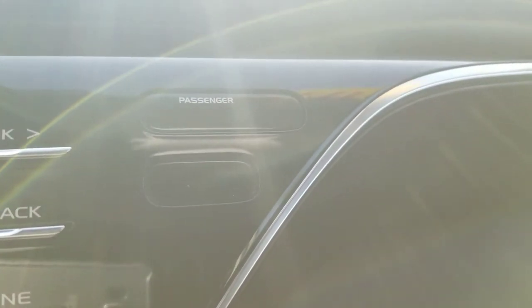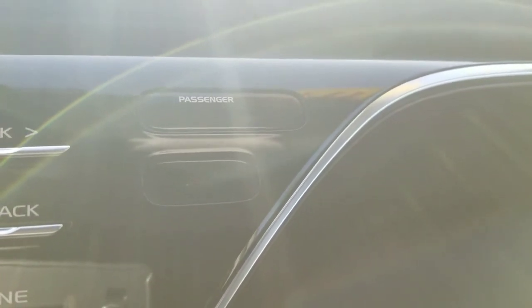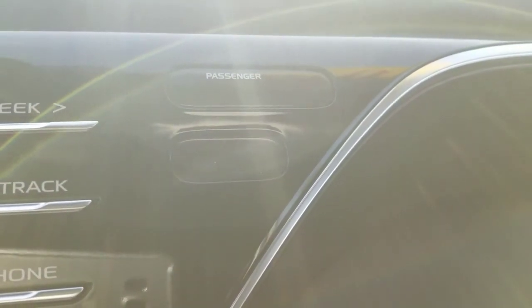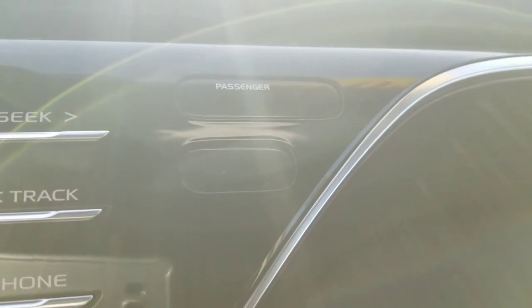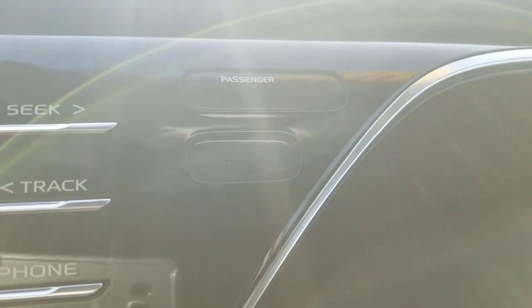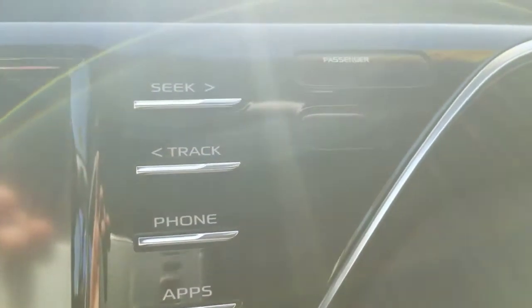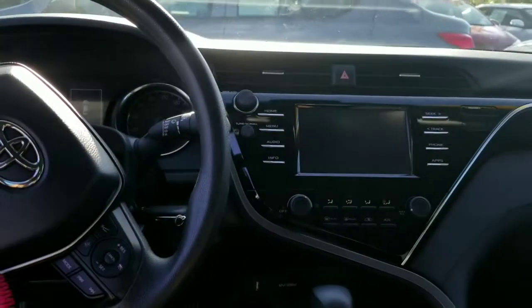It says not to turn on the car, so I'm going to press yes. Now it's telling me to wait for the security light to turn off. I like the way it's flashing — it's only flashing once every couple seconds. That's a good sign, because typically when you have the wrong chip in a key, that light would be blinking twice and then once. What I'm waiting for is that 45- to 60-second protocol wait, and then the light should stop flashing. That lets me know the immobilizer section is done.